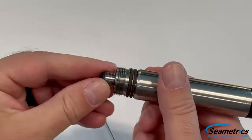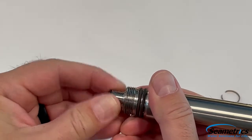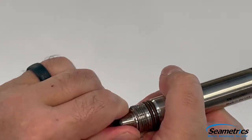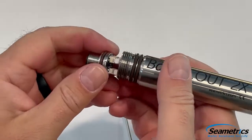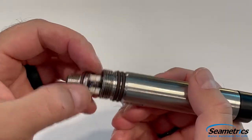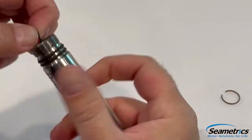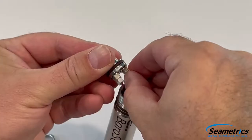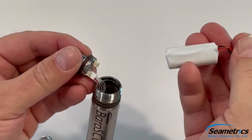Next, we're going to coax out the connector. We're going to move slowly because if we pull too fast, we could damage the connectors. We're going to go ahead and take a look at the connectors — the small one is the battery, the large ones are the terminal wires. We'll go ahead and pull the battery up just a little bit and disconnect by depressing the little button on the side. The battery comes out like so.